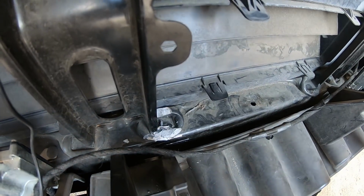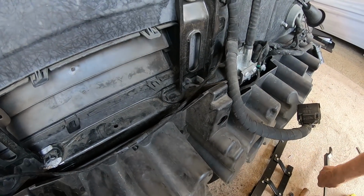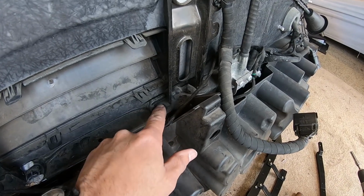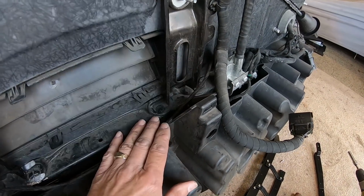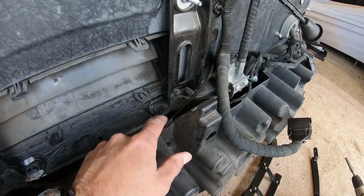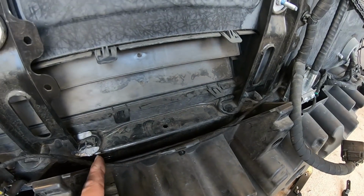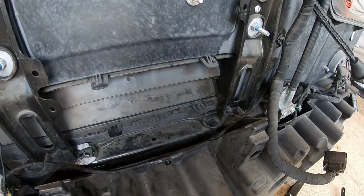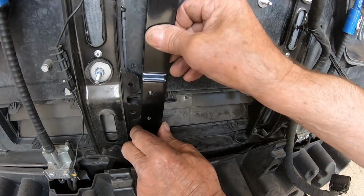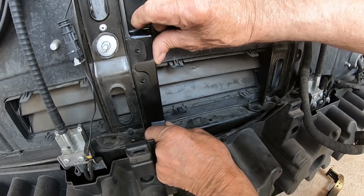That's now looking better. So guys, just to bring you up to speed, both sides have this epoxy goop that they put this assembly together with, which puts the tub together to the frame, and it has run out, and so that was the same thing over here. So we're trying to make these uprights that Terry's going to go ahead and put in here now fit. So we're just chiseling out that excess to where this will line right up with the screw holes.